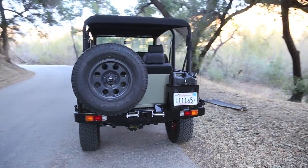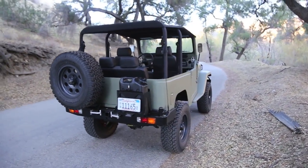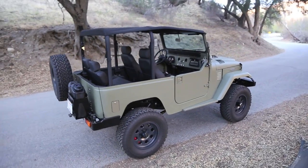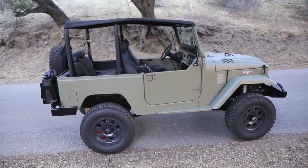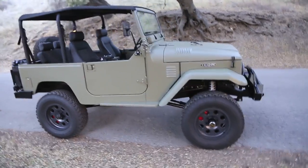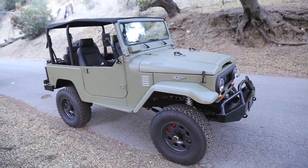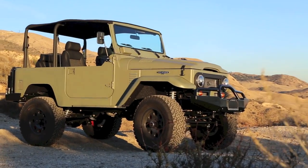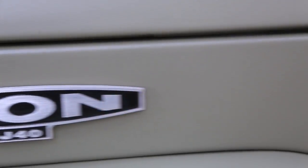The client wanted it topless, but the windshield frames jiggle around and that just drives me nuts, so we built him this custom bikini top as a bonus. It's an insulated top crafted out of three-ply Mercedes German canvas with Bentley 10x snaps and nylon hold-downs that are all UV stable. There are CNC collar braces and one-inch tubular forms that go from the roll cage to the windshield frame, so the bikini is tethered around that — nice and quiet but keeps its shape.